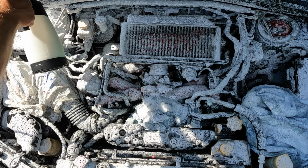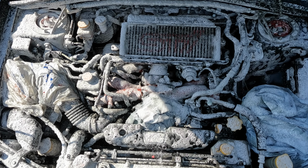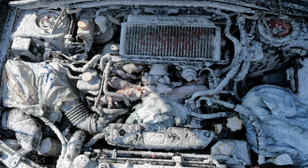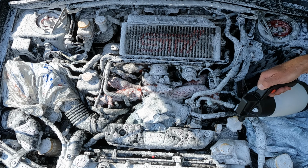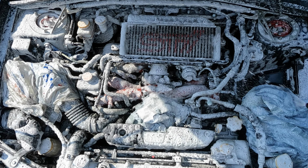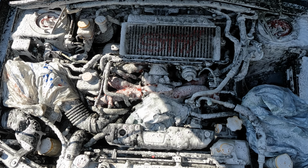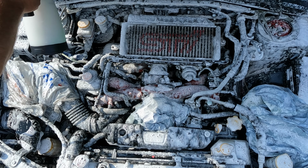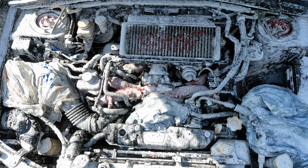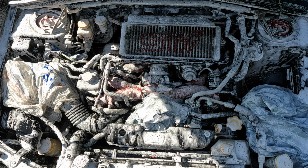not going to get in super close or jam water into injectors and things like that. So key areas, you know, create a little bit of distance just to exercise caution. But also going to use the big boy blower to dry the engine bay, which should be good. Prevents any water dwelling in areas that it shouldn't be. So we'll just give that a little sit.